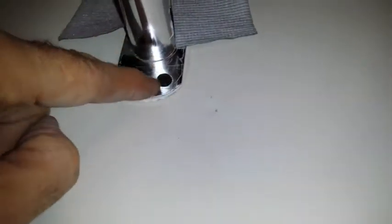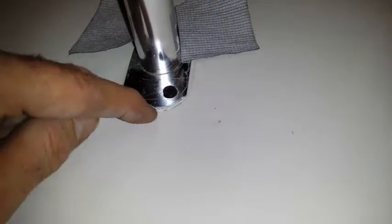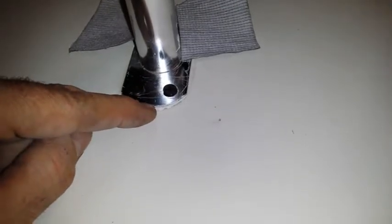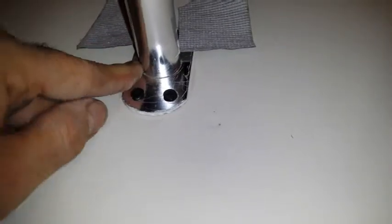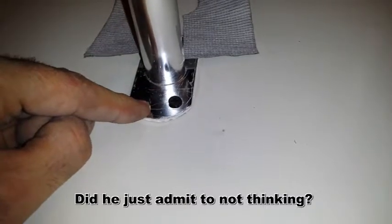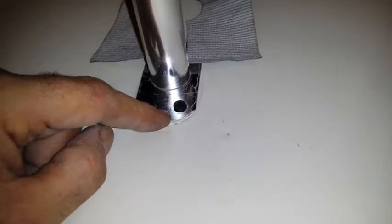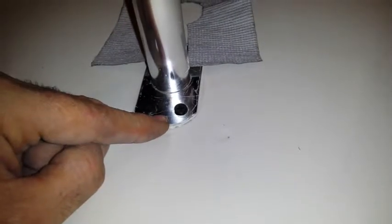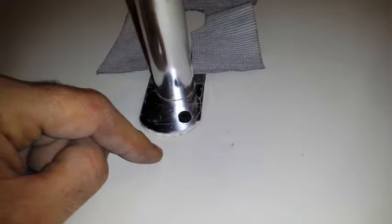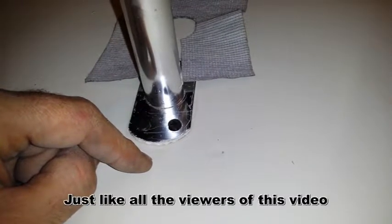But with these screws holding this down tight against this rubber roof that's sealed underneath there, so water can't get underneath there. It wouldn't get underneath there very easily anyway, I wouldn't think. And then with the tape sealing over the heads of the screws, and then the tape sealing against itself back here, and then the final coat of the paint over the top of it, that will be waterproof. And if it's not, I will rue the day.